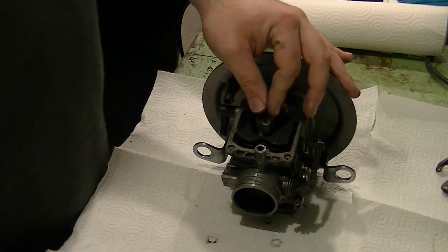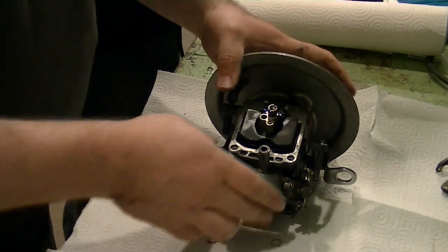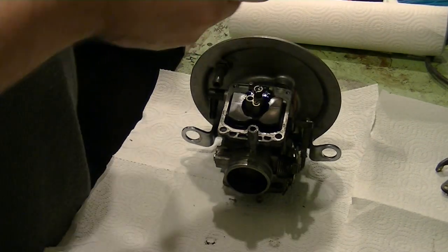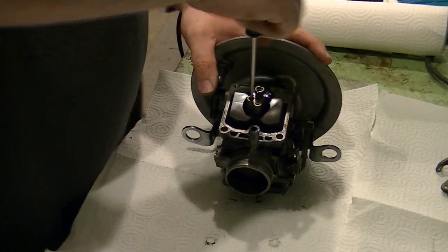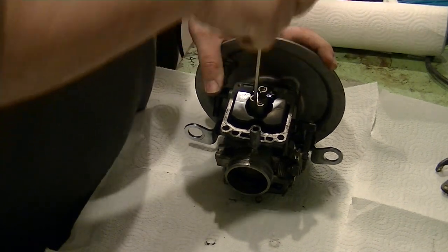All right, so let's see what the heck we got in here now. We're at a 180. Now, the real question is, it tells me to run a 185. Yeah, 185's a hair bigger. This is telling me I don't need a 195 unless I have cams. I need a thinner screwdriver so I can get down there and get your slow jet out so we can take a look at it. Right, this is your slow jet down here. I think stock for you is a 45.